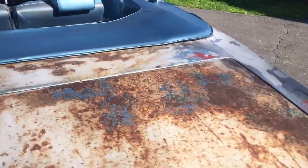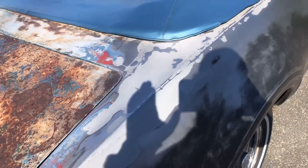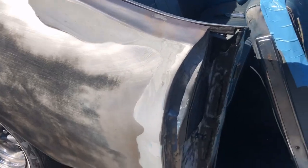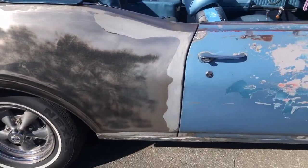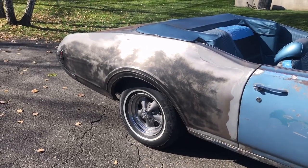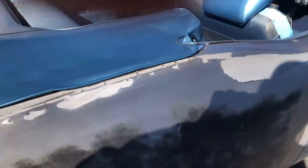There's a lot of metal work in this car. This area up here was really, really bad where they grafted the donor quarter assembly — the inner wheelhouse, the trunk, the door jamb — the whole thing. That was from a white car. It was a lot of work. They just didn't do it well, but I improved it. I have lots of pictures of cutting that apart and fabricating a lot to make this quarter panel match up here, because the convertible line is different than a coupe — that portion has to be saved.